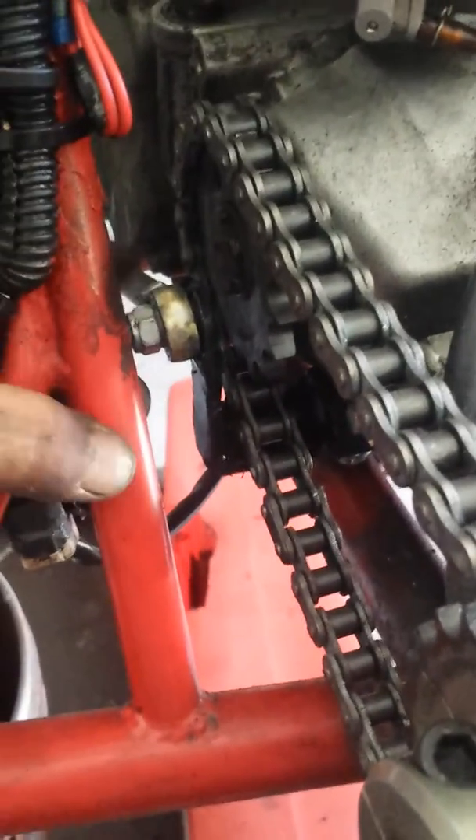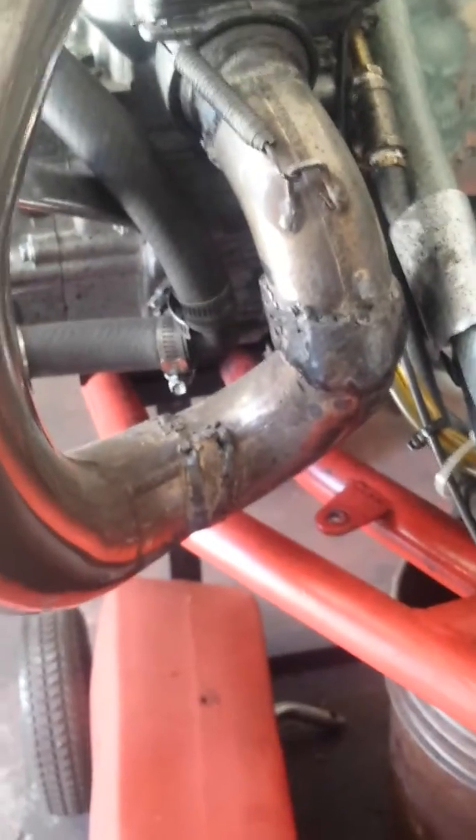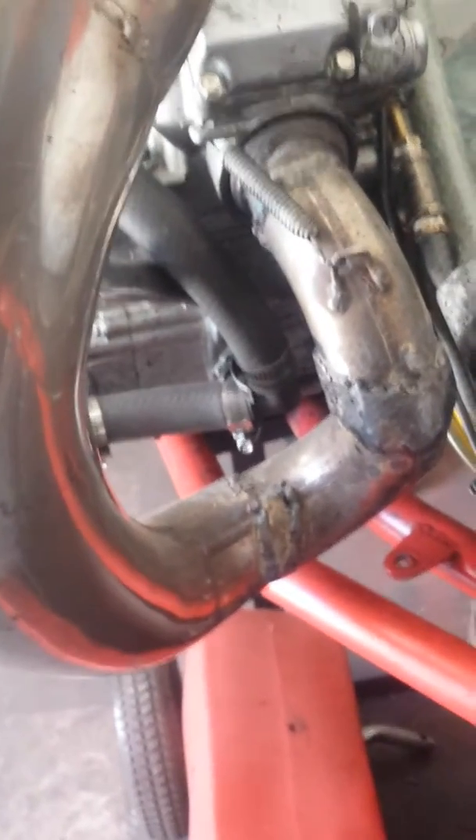You're going to have to do a lot of modifications. This is a J-bar down here — this is where you'll be shifting from. I took tie rod ends and welded a couple of tie rods together to make the shifter. Since nobody makes a shifter kart exhaust pipe for the KX 250, I had to do custom modifications to it. It's not the prettiest, but it's fast. Make sure you mount the pipe and silencer solid so you don't have any issues with it cracking off.